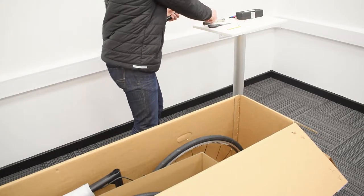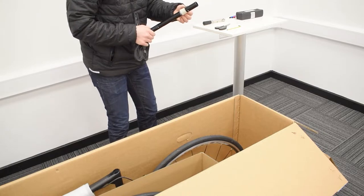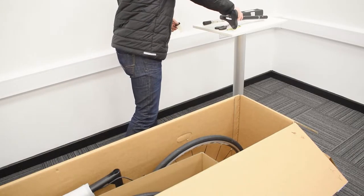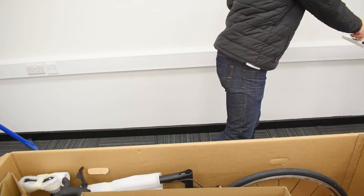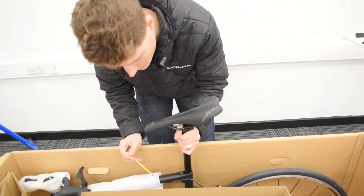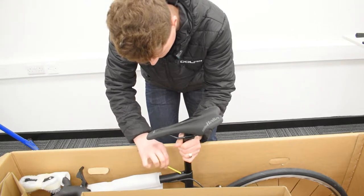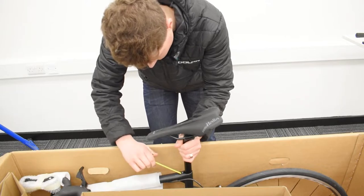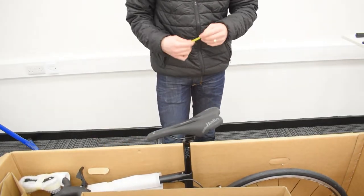What we're going to do is cut that away nice and carefully. Take the tape off there — the seat clamp goes in first, so just pop the post to one side. In order to attach your seat post, pop the clamp in there, grab your seat post and your 4mm allen key — it could be worth using the allen key just to keep the seat clamp out of the way of the post. Tighten that up with your 4mm allen key. That should have a maximum torque setting of five and a half newton meters for those of you with the torque wrench. There we go — there's your seat post attached.